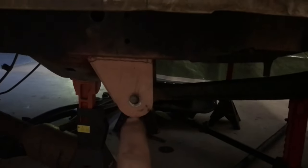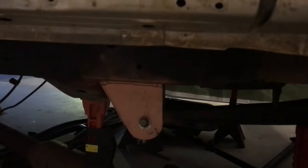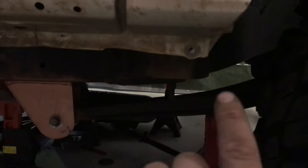You'll notice that I had issues in the video. I think I explained it, how I had the steering arm contacting the radius arms. So that's all been changed now. It's all been flipped. The chassis side brackets have been changed. I've had to drop them down from the rail about 45 mil, just so I can get the arm to clear on up travel. When she goes up, she'll hit the chassis about there. So that's all been fixed.